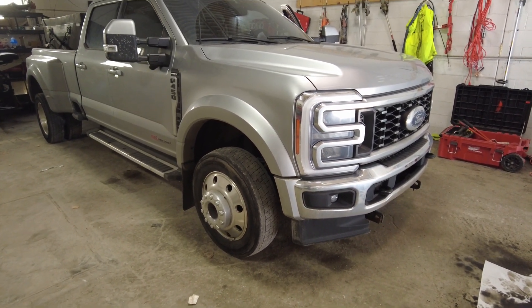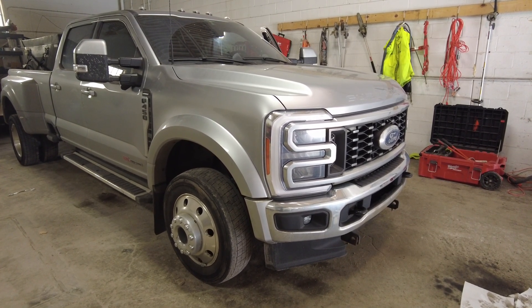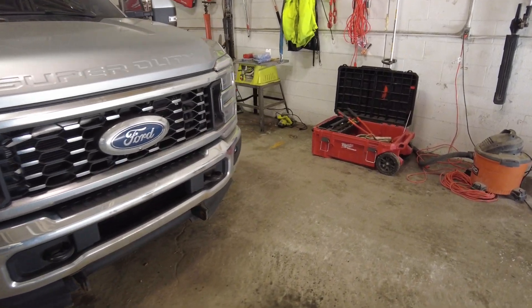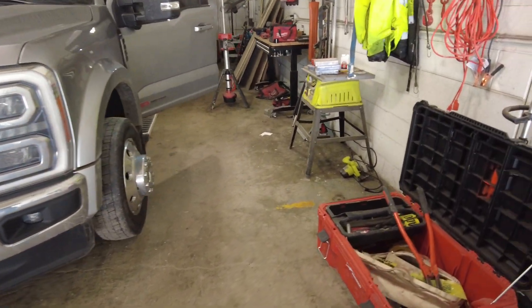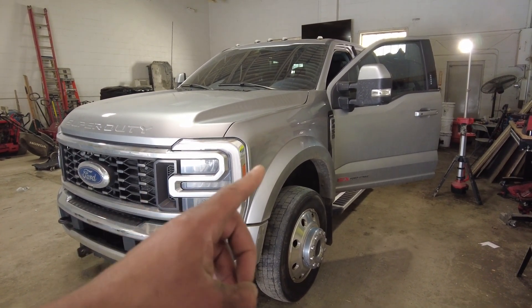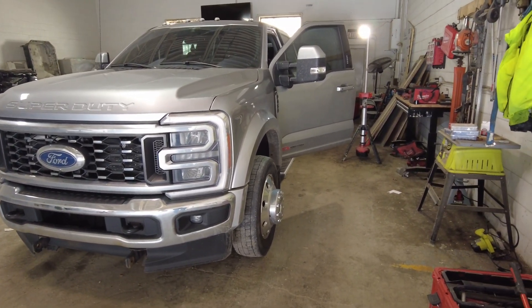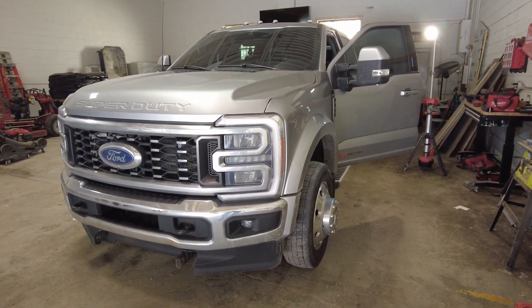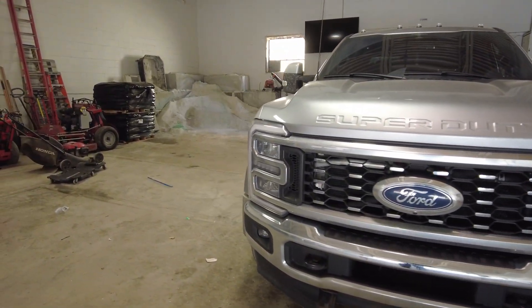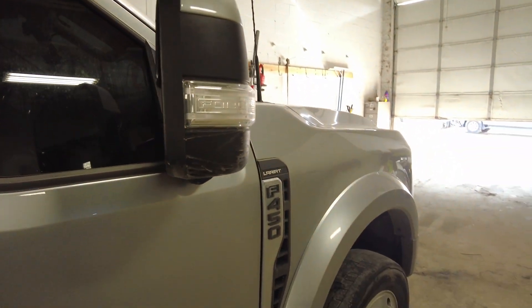As far as issues it's caused — we have a lot of salt on the vehicle, but the only problem I've noticed with this truck is the temperature gauge reads crazy on snowy days. When it's real snowy and you've gotten in and out a couple of times, it'll read like 100 degrees outside, which messes with the HVAC. I thought it was a temperature sensor, but when the season ends, the gauge starts working again. It could just be all that salt on the harness transferring a little bit of signal. The temperature sensor is on the passenger-side mirror, which was loaded with salt.